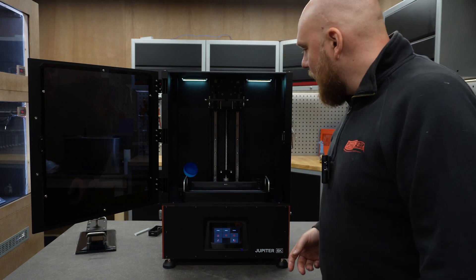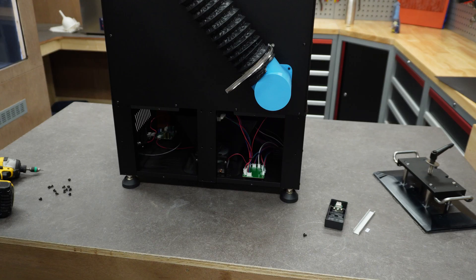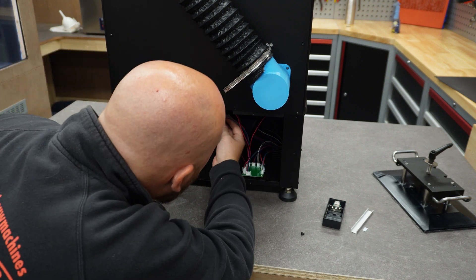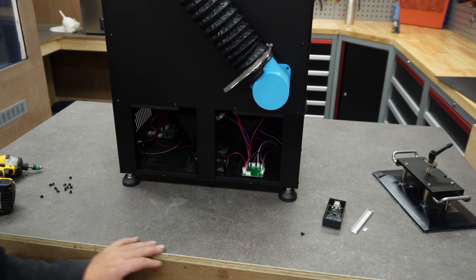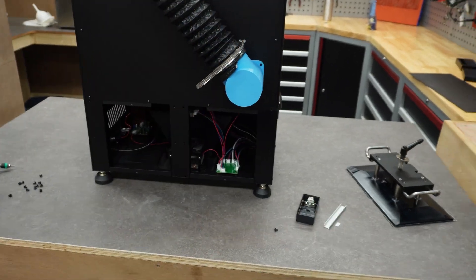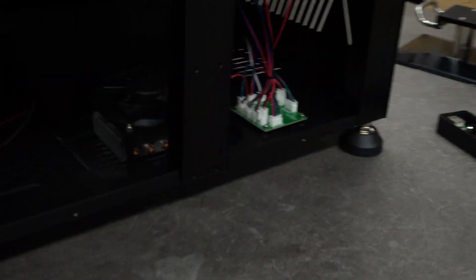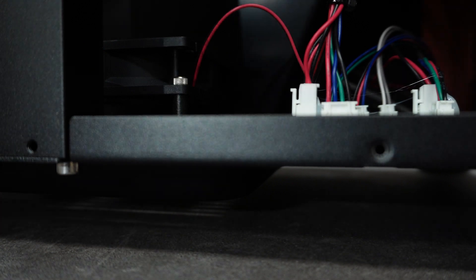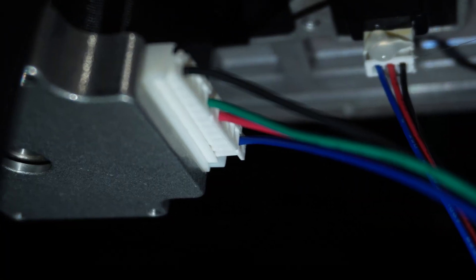Let's investigate. I'm going to open the back panel and give it a look. I've removed the back panel — let's check some connectors. These are all fully in. Oh wait — Houston, we found the problem! Just like I thought, if you experience some vibrating noises, there's probably one of the three phases gone rogue. And this is what we found: the motor connector is not fully seated. We got it fully back in there.